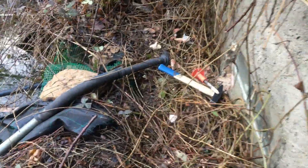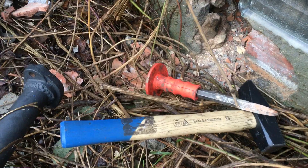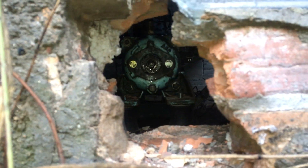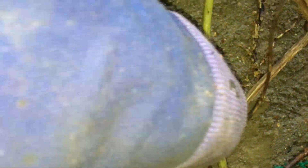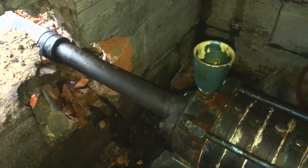This was to prevent the vibration from getting the nuts and bolts loose, as it had happened before. But obviously those silent blocks had raised the whole setup about 60mm, so now I had to make the holes bigger to accommodate the intake and the outlet pipe. Here you can see the hole for the inlet water pipe, and here I also had to make the hole bigger for the outlet. After this was done, I bolted both pipes to the pump with help of some silicone sealant.